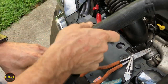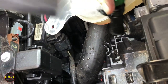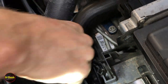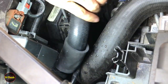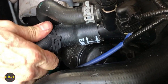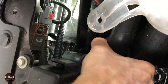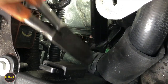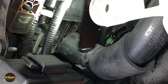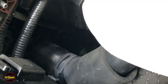Now let's get it back on where it goes — we'll do the radiator side first. We'll run this hose up to the notch that's molded into the plastic, and on this side just want to make sure it's flush against this piece right here. You can see the same kind of notch approach on this side — just want to make sure it's flush right there. Now comes the hard part of getting the tools in here to re-clamp it, so we'll do the engine side first.